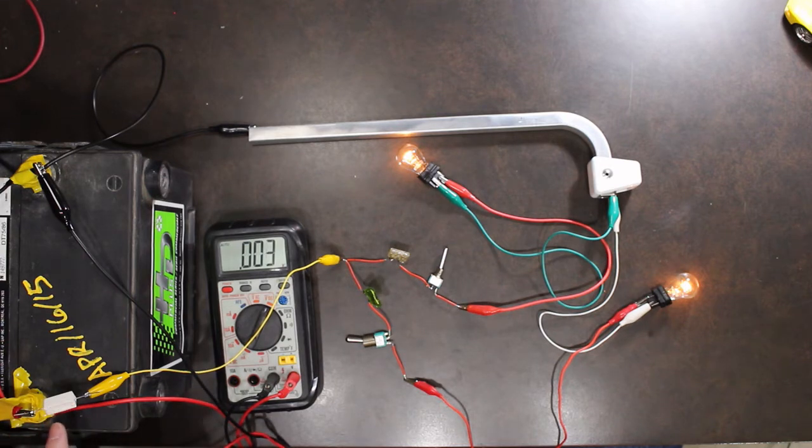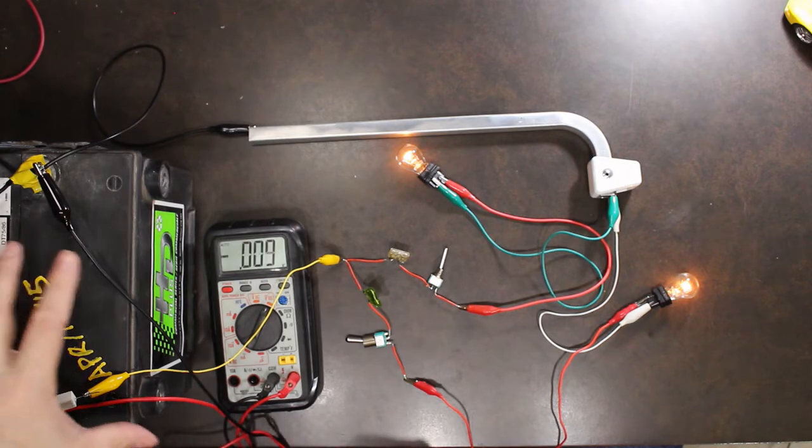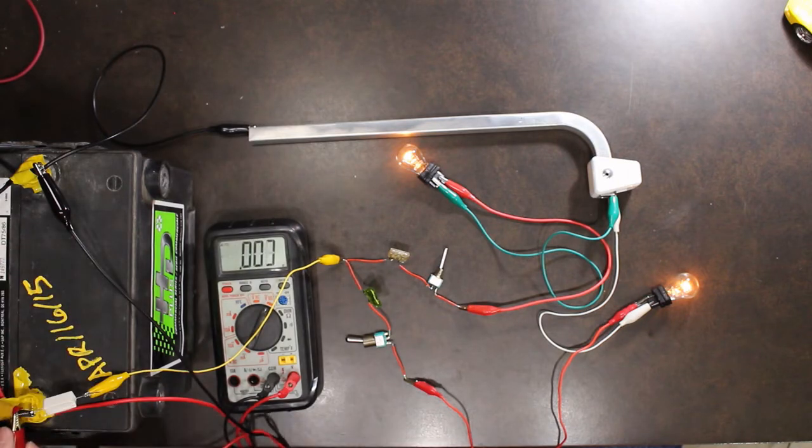It is very common. If you find a bad connection on the positive or the negative side of the battery posts, clean them both, so that you're starting off with always a good connection leaving your battery. So again, go directly to the post of the battery and then touch the actual connector that goes onto the battery and see if you see a difference in voltage. If you do, then the connection is bad.